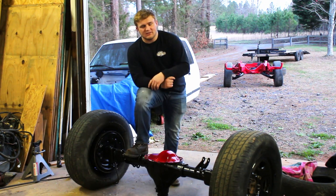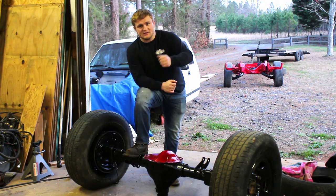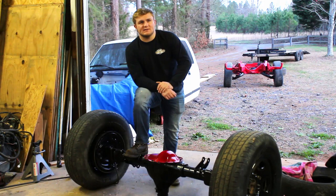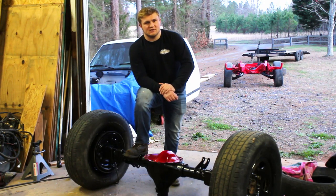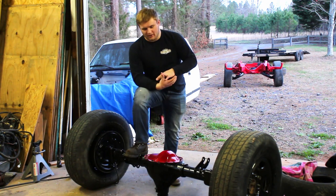The guys online were saying that I needed to go about 3/1000ths deeper, so about 3/1000ths more shim depth. I think I'm at like 0.025 or 0.026. Wish I ran it a little bit more, but it'll buff.